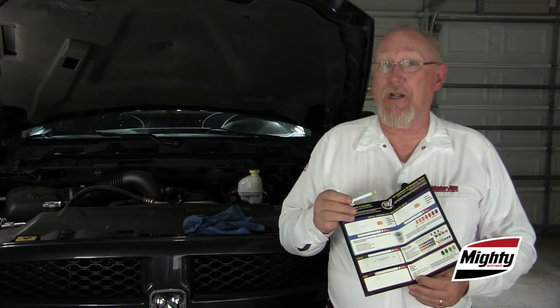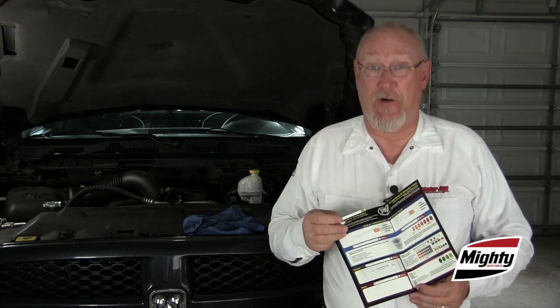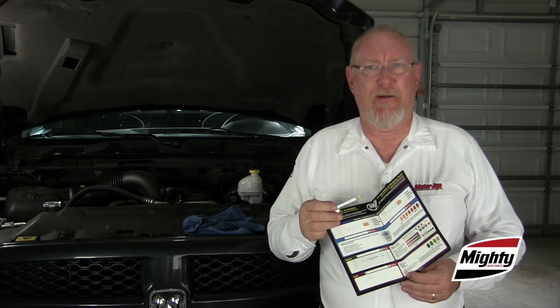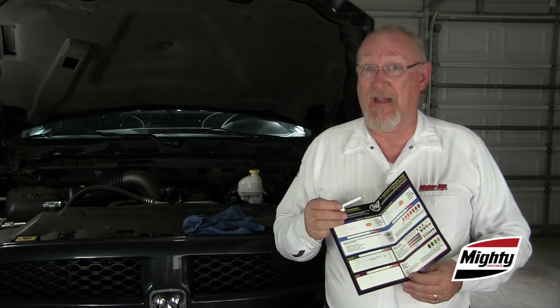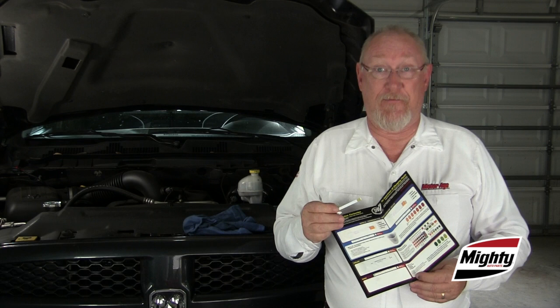Be sure to share the results of your tests with your customer. And if the test failed, recommend a brake fluid service. Explain to them that the cost of the service is a lot less than the cost of an expensive braking component like the ABS module that could be damaged by the effects of corrosion. They'll save money, you'll have a happy customer, and all it took was a mighty minute.